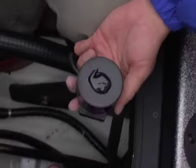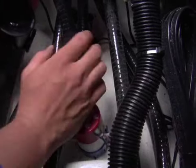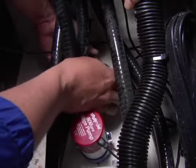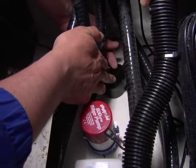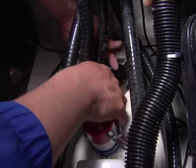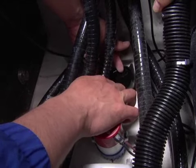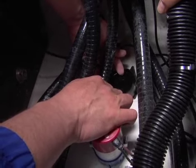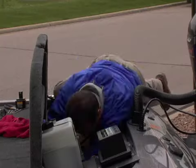Now we're going to have to wire it back through without hitting any of the hoses and wires. You've got to make sure you get it out of the way of the hoses. Place it on the smooth part of the hull that we cleaned and prepared and just hold it there. It's important to make small circular motions so you start seeing the epoxy come out. If you have any rocking at all, the preparation work wasn't good enough — you have to go back, sand it, and smooth it out a little bit.